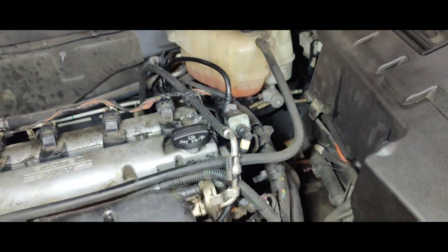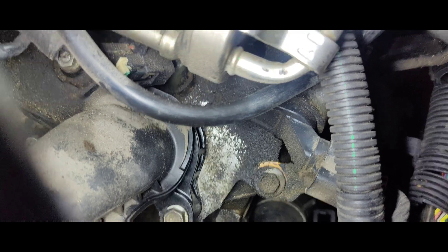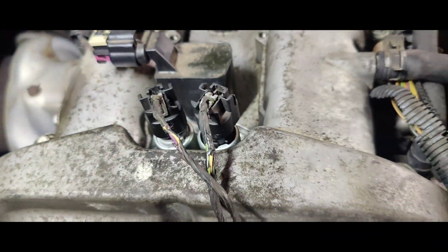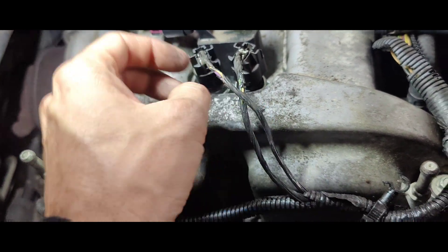I was doing a quick look at this Pontiac and I noticed they said the cam sensors were replaced. This one definitely wasn't replaced. I came back here and quick looked because I wanted to do a cam-crank. The one right here does not look like it was replaced. Those look like they had the valve cover off — you can see RTV smeared everywhere. But then I was wondering if these are crisscrossed, because it looks like they're crisscrossed.